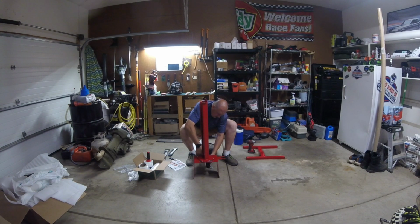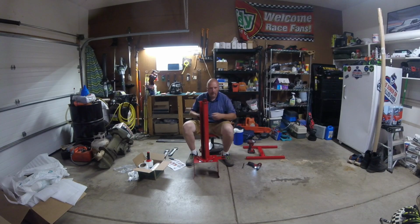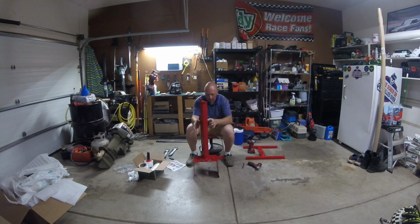Get it close, and then once it stops free spinning, I give it just maybe about 2 to 3 little pops on the ratchet end, and that's all I do on my chainsaw bars. I don't want to go too tight, even with that little guy, and end up pulling the studs out of the case or something crazy, because in my world, that's how my luck works. So, okay, groovy, that spins pretty easy.